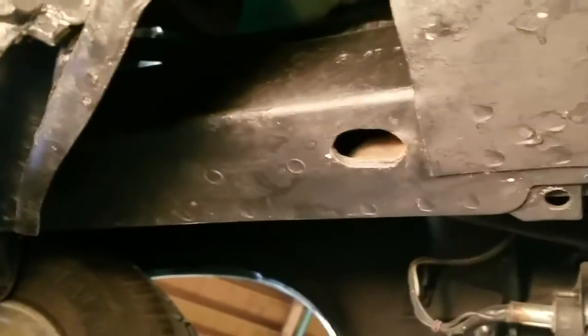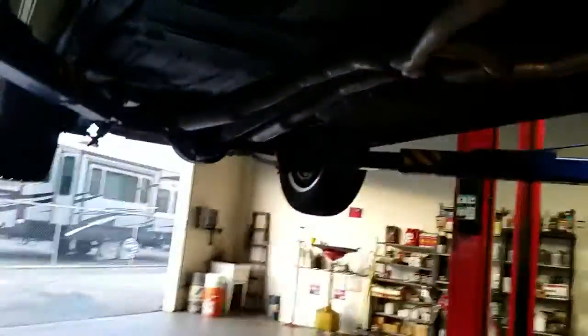Dust shields — I don't think those were ever restored. Unitized frame rails are in very nice shape. Lots of visible OEM spot welds. No crush point marks, no unusual damage you can detect up in the upper portion of the frame rails. No hook marks of anything substantial. Looking down the aprons and spot welds, I don't see any bends, falling apart, or splaying.